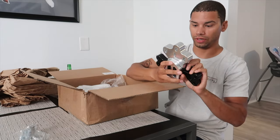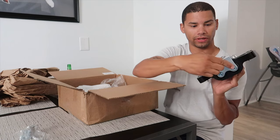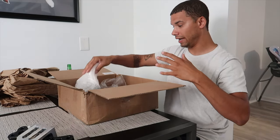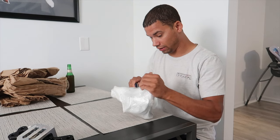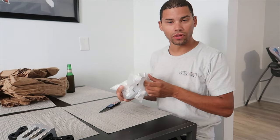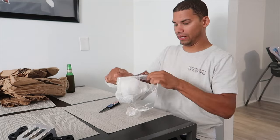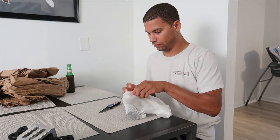These come apart and you can replace the bushings inside to go to a stiffer durometer — that would be the Stage 2, which they call the Track Sports. These are the Street Sports. This transmission one is really nice — I just need to make some markings here to confirm nothing's moving. They are more expensive but they're readily available. I ordered them from Sean at It's Not Stock on Sunday, today's Wednesday, and they're already here on regular shipping. The only thing is the hardware doesn't ship with it unless you order directly from 034 — the hardware comes separately from California.